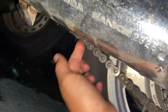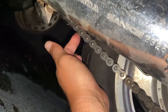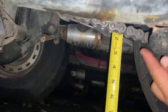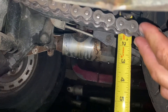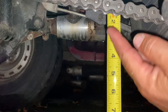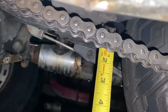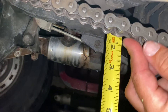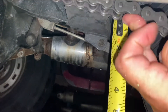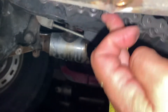We do have probably enough travel — this is the tightest point and it looks like I need my tape measure but it looks all right. This is the tightest point of the chain where I parked it and it's not floppy. You want to find the midpoint of the chain — between the front and rear sprocket — for the largest travel measurement. My chain was cleaned and still looks pretty good, just needs oil. We're supposed to have an inch of travel, and at this tightest point we have about an inch. Before we had nothing; now we turned the adjuster about half a turn.